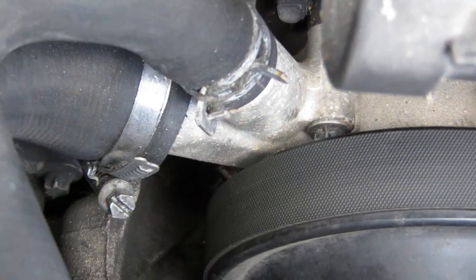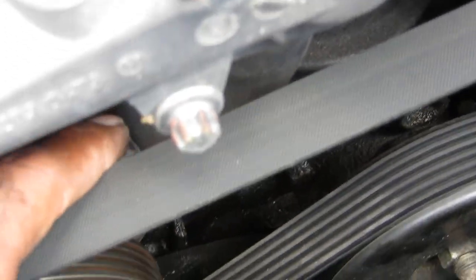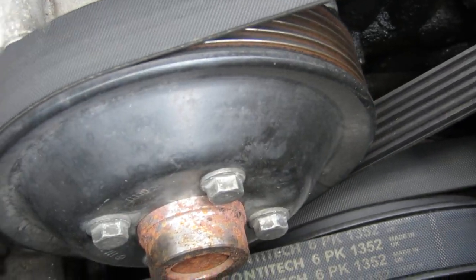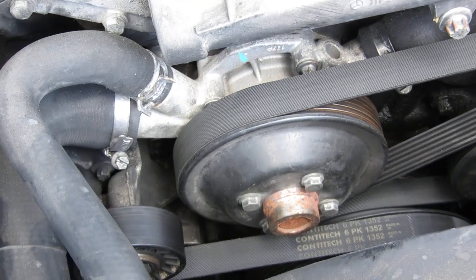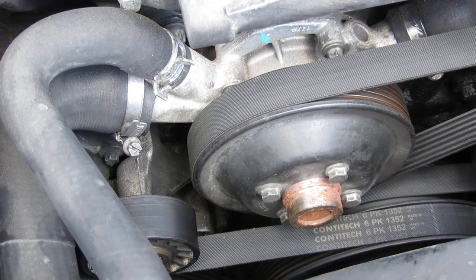It's not that hard to use a clamp to take the hoses off. Flat head for this one, flat head for this one right here, flat head for this one right here. So it's three hoses: one, two, three. Then you can see what's behind there. Let's pull this thing off and change this water pump — let's see what we can get into.